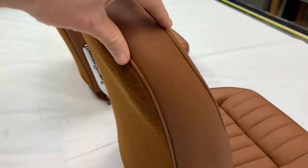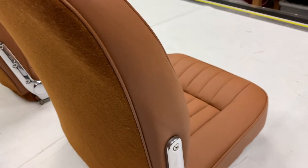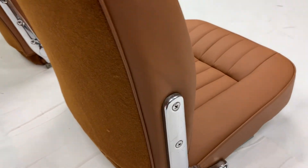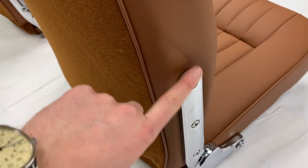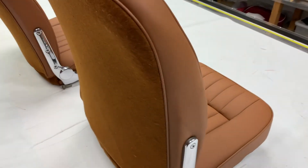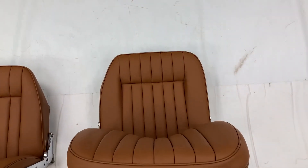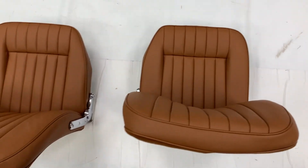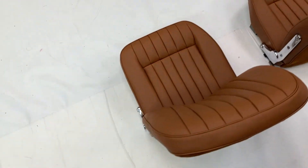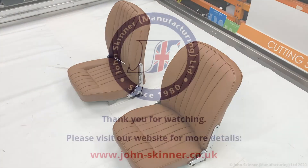The principle of it is quite straightforward. The main areas to focus on are this curve shape here of the piping, making sure it maintains consistency around the frame, and then the hard part is locating the holes here for these fittings. Take your time, and make sure your pleats between cushions and backrests match up as you go along, because it's a lot harder to adjust after the fact. See our handbook for more help and tips on how to trim these seats, or if you prefer, just let us do it.